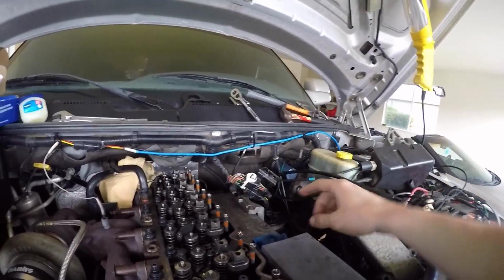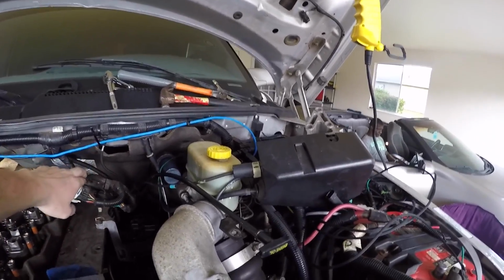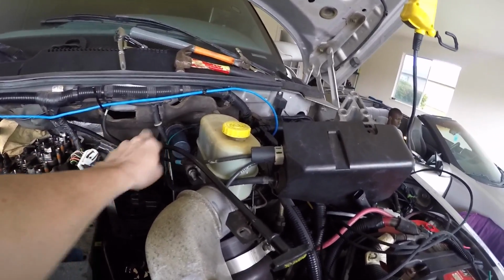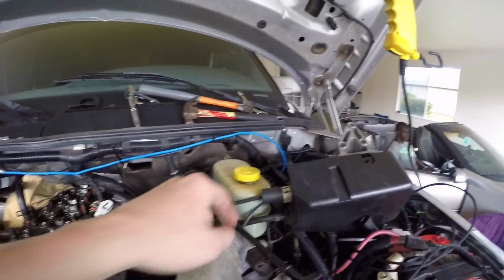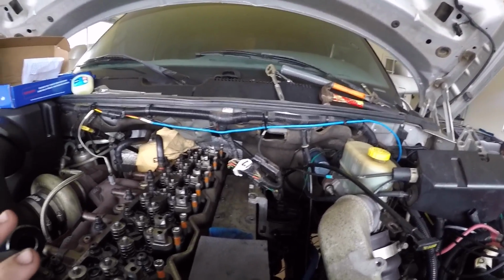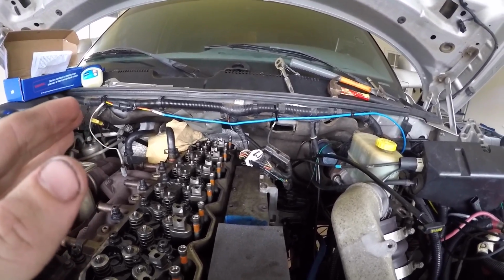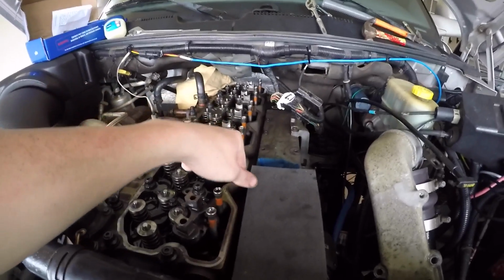So in all there is, I believe, 5 bolts, because you're going to have to do another one right here that connects to the wire. It's a wiring harness that connects to a bolt, and then there's also a little pry clip that you have to just pick up and out going to the throttle position sensor. So to get to this point right here, I know I haven't recorded since I took the fuel lines off, but all you guys got to do is pop these things out.